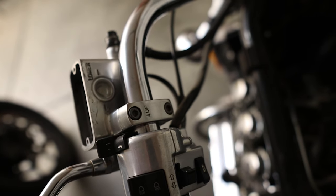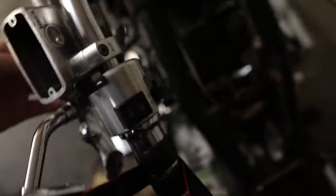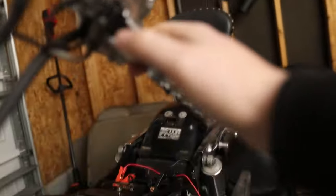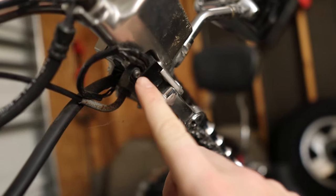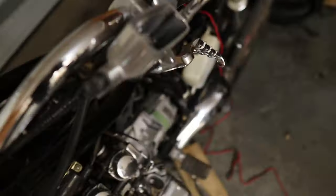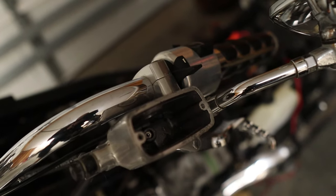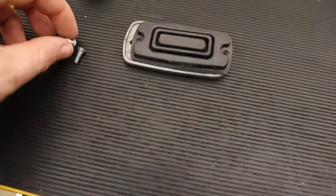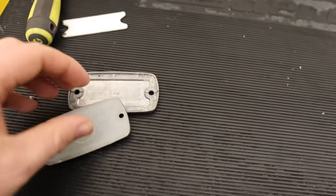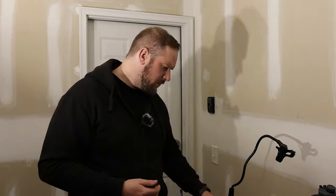You're going to want to take out these two bolts right here and also loosen this off. There's probably going to be a clutch switch, and you'll want to remove that clutch switch as well — so that's four bolts total. You obviously do not have to have this already opened and drained, but I do already have it off because these bolts were a little bit mangled, so I just wanted to make sure I could actually split this open and get to rebuilding it.